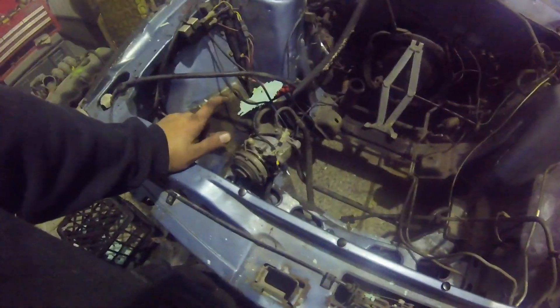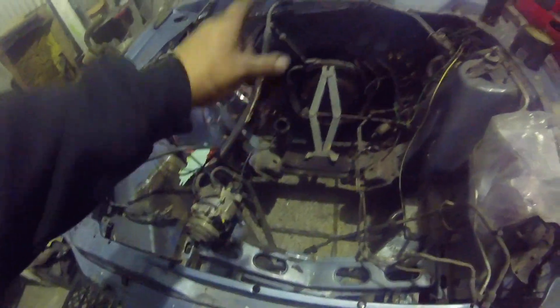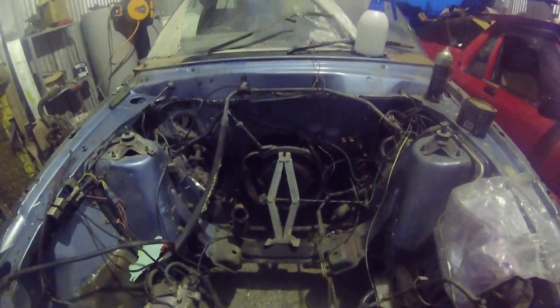Next thing to do is get this thing rolling — I'll get it outside and clean it out. We're going to pull this gearbox out next, but that other car's got to go first, it's just in our way. The exhaust system's got to come out, gearbox has got to come out, and we're going to flip the gearbox and service the Borgwarner 35, change the pan filter — which may have never even been done.